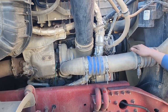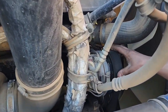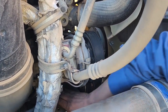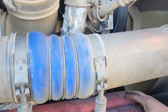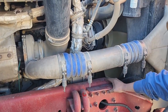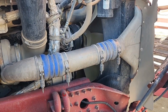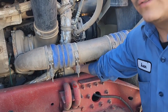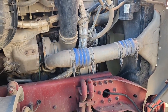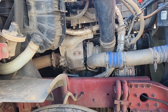The last thing you want to do is start the truck up and check your voltage coming out of your alternator — the alternator is down here. Make sure you've got a good 13.9 to 14.1 volts. Anything under 12 volts and your alternator is not charging. Anything over that range and we're probably going to have a problem with our batteries.